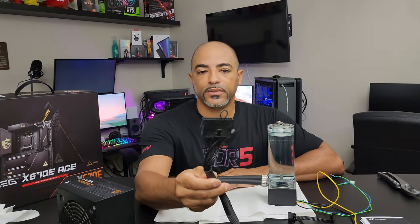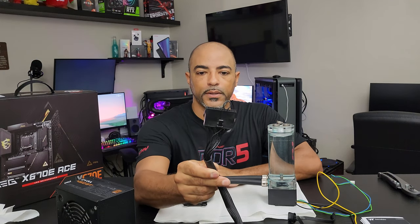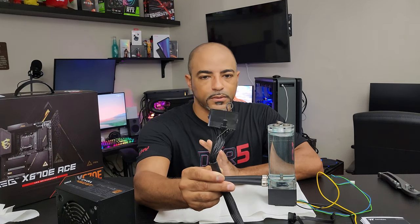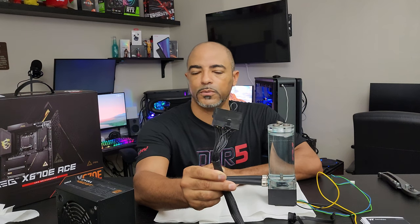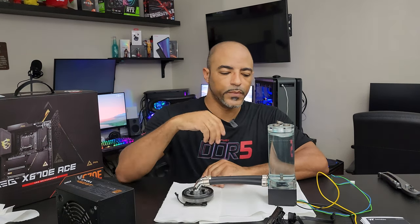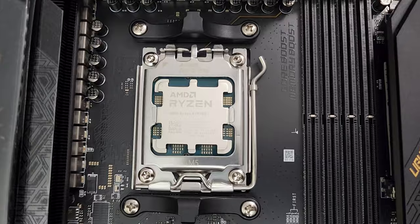The point of this video: leak test your stuff before you slap it on expensive hardware, and I think we did a successful job of showing why. When it comes to the power supply, there's stuff like this — you see this loop thing? It's an extension that you just slap on that motherboard connector. It shows the power supply that it's plugged into something correct. There's a paperclip method but I don't like to show that because people might shock or burn themselves. This thing is just like three bucks off Amazon, and I think Micro Center has them too. In the next video, I'm going to show how to properly apply this on an AM5 processor — specifically the 7950X.